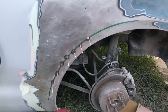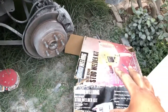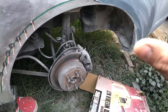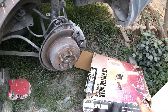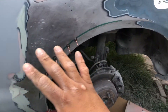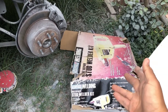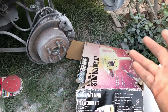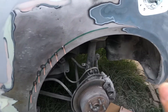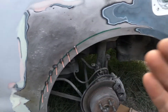Huge shout out to my friend Ricardo Moreno — back when he had a Honda Prelude, someone hit him on the quarter panel and I gave him a suggestion: let's go buy that Harbor Freight stud welder kit. It's about $100 on sale and we could probably get your quarter panel out. So we managed to get the huge dent out of his quarter panel and had it through a layer of bondo, sanded down and ready for paint.